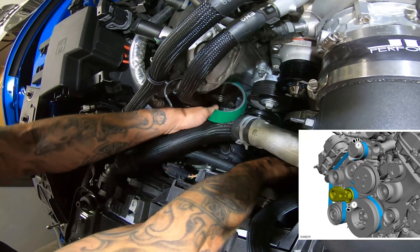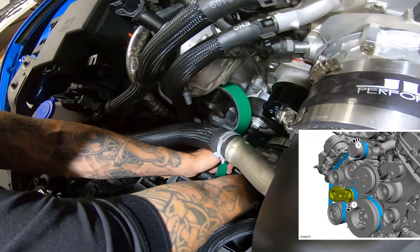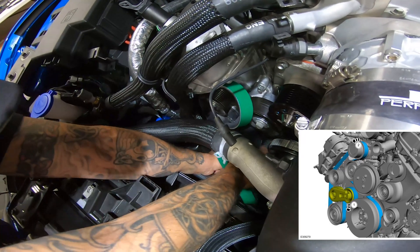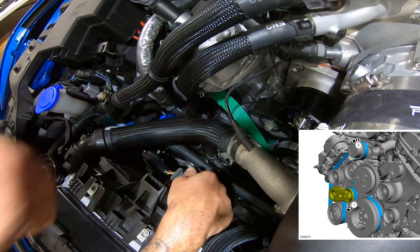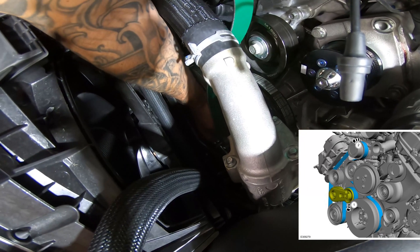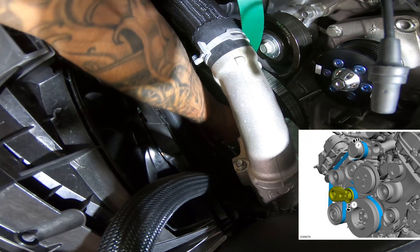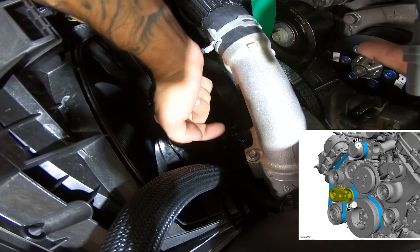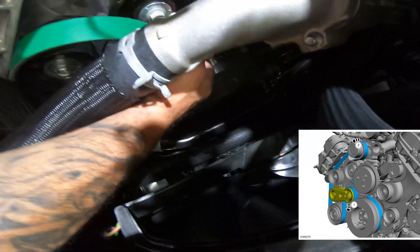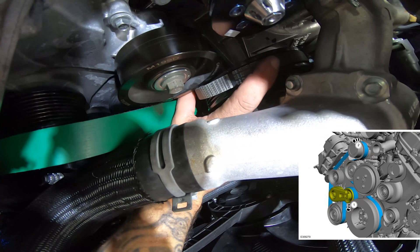The other side is going to go down from the tensioner pulley under the crank. We can't get a camera in there very easily, but you're going to have to trust me on this one — on the other side of the crank in that way. It's a little tricky to slide that belt between. You have to have the belt very flat against the crank to slide it in that way, because the other tensioner is over in that area and it will get hung up. Also be sure not to knock the water pump pulley off — we want to keep everything on as best we can.